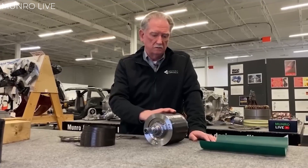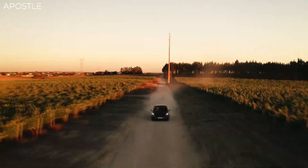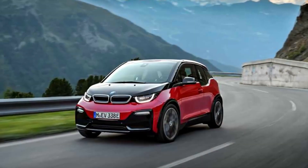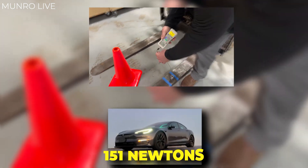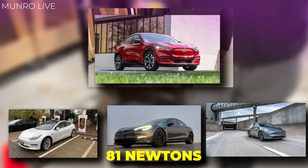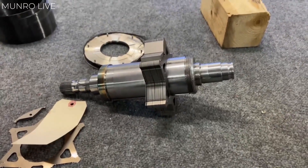The permanent magnets utilized inside the Plaid rotor are importantly more powerful than your average electric car motor, even significantly stronger than Tesla's standard motor. Munro did a little unofficial practical test by measuring how much force was needed to pull a bolt away from the magnet, using rotor magnets from a BMW i3, a Mustang Mach-E rear motor, a Model Y rear motor, and the Plaid. They discovered that the Plaid needed 151 Newtons of force to pull the bolt away, while the Model Y requires 112 Newtons, the i3 requires 93 Newtons, and the Mach-E just 81 Newtons. So the magnets inside the Plaid rotor are nearly twice as strong as those in the Mustang Mach-E rotor, and over a third more powerful than the rear motor in a dual-motor Model Y or Model 3.